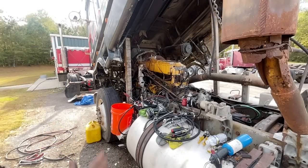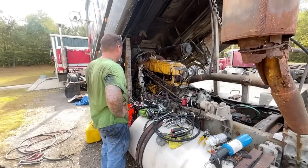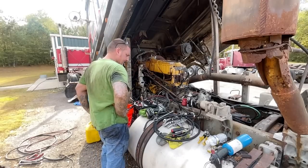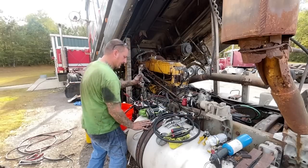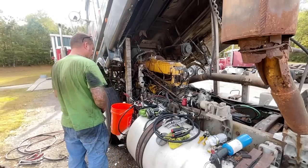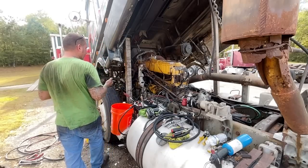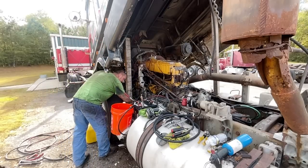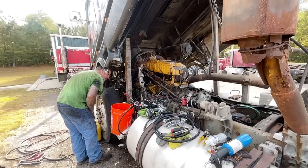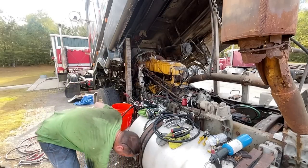All right, so while you were gone, I put on the missing injection pump lines, plumbed in a fuel pump. I'm running fuel through it right now. I'm just gonna crank on it just a little bit. Now anything can happen, this thing can run away. If it starts to run away, I'll disconnect the fuel. I'll run around, I got a board over there, and I'll snuff out the turbo. It shouldn't get pressure in the fuel lines because I've got them all loose on the pump.